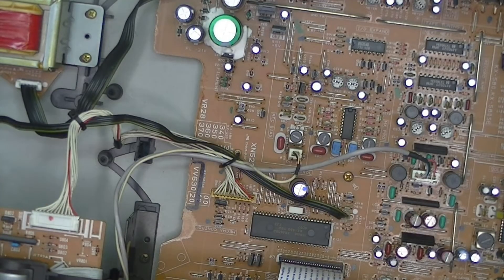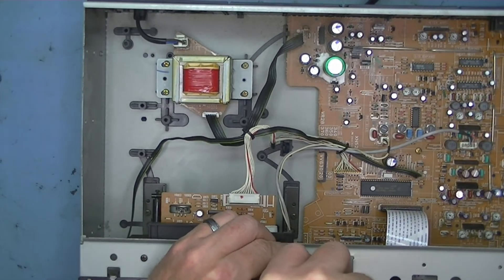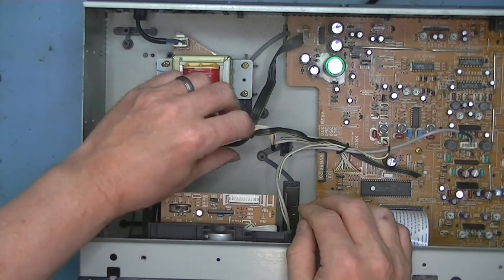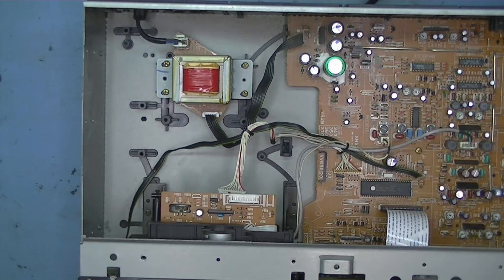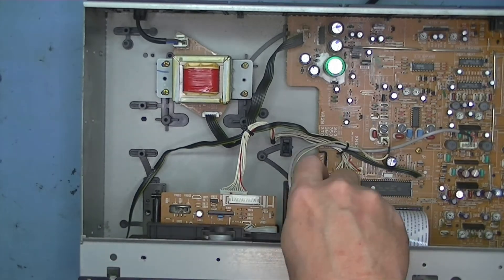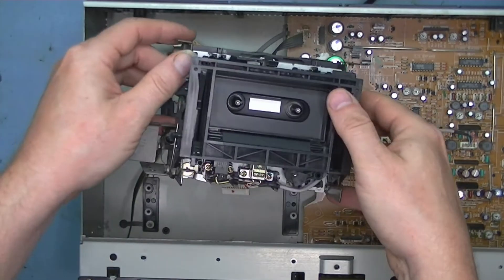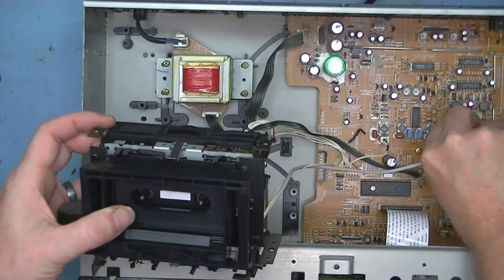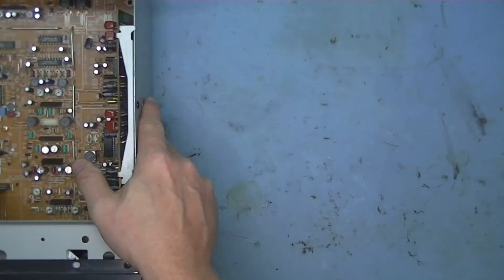What we'll do is pop the mech out. You've got a couple of screws on the top here, then just disconnect that cable and move the head cables to the side. There are two screws down on the bottom on either side which we need to take out, and usually you can just pull these mechs backwards and out. You might want to release the clip there to get your head cable out — you can disconnect the heads totally if you want to make it easy to work on.